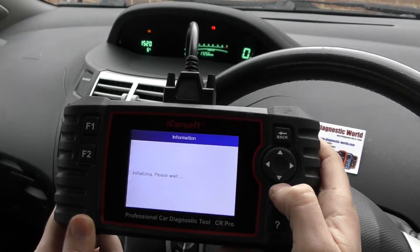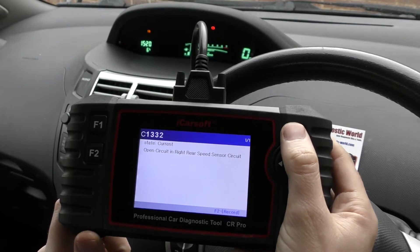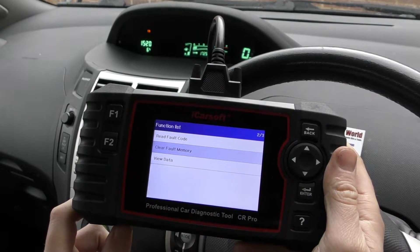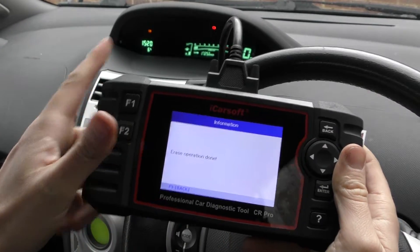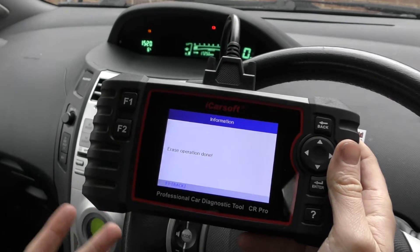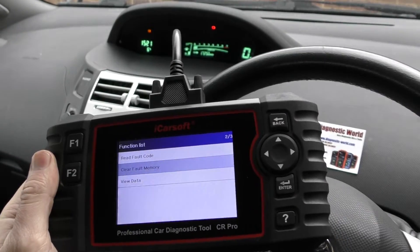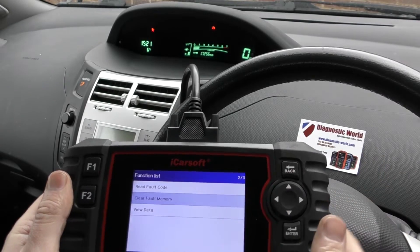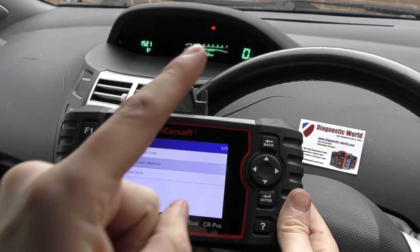Then we've got one more — the ABS light. We read the fault code; we had unclipped the rear right ABS sensor and put it back in, but the ABS light is still on. This works in a slightly different way — in this vehicle we can erase the trouble codes but the ABS light will stay on; in other vehicles it may go off straight away. So we've erased the codes but the light is still on. What this car requires is an engine off and then an engine restart — all of the lights will temporarily come back on and then they should all go off again. There we go, all lights are off.